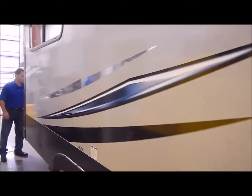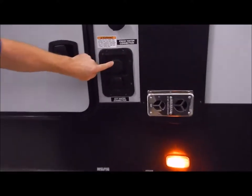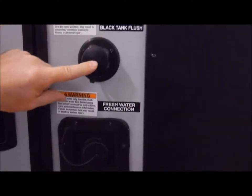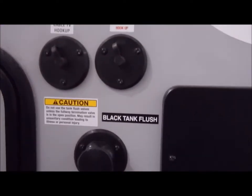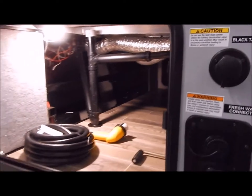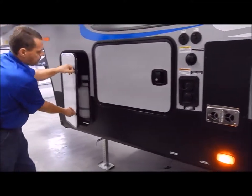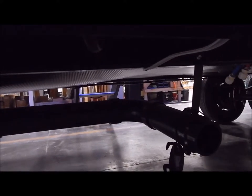Moving up in front of the slide-out for the rest of your hookup and dump station: you'll have your furnace vent, fresh water and city water connections. City water is where you connect your water hose at a campsite; fresh water is where you fill the fresh water tank for dry camping, then turn on your water pump switch inside. Here again is your black tank flush for the main bathroom. You also have satellite and cable hookups, pass-through storage, the 50-amp detachable cord, and the second LP bottle up front. At the dump station, extension handles come out for easy reach, and all valves are enclosed and heated.